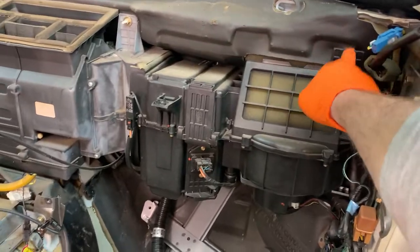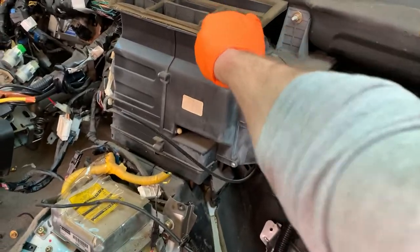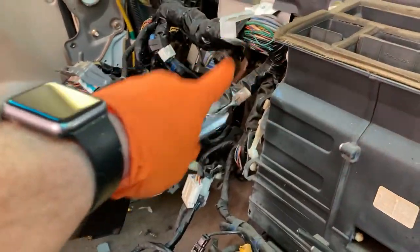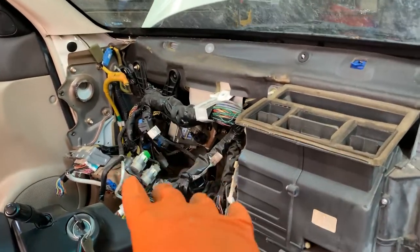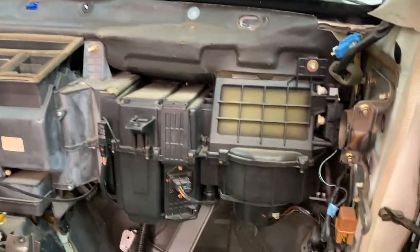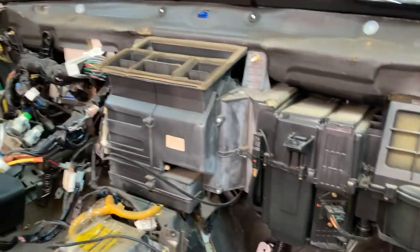And next up, there's just a lot of these small nuts all the way across. So I'm going to disconnect all that stuff, start getting the heater core ready to pull back, and then start cutting out what we need from the harness. So I think what I'll do is go over here, take my tin snips, cut all this stuff, go into the steering column, because we don't need that. That'll allow the column to drop a little bit more and stop putting stress on the main harness over there. Then start pulling the OBD2 port and the fuel pump harness. So we'll get that side kind of laid over, get our heater core off, pull back our AC unit, and then we can get this main relay out, kind of strung from behind there, and get the rest of the harness coming out too.